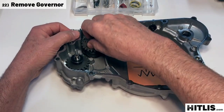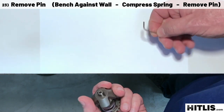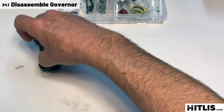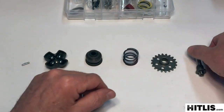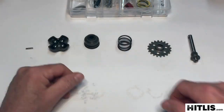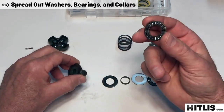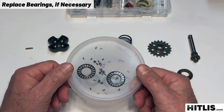Then lift up on the governor, lift the arm, pull it right up out of there. Go over to a bench up against a wall, grab a little Allen wrench and compress that spring, slide the pin out, and then you can take apart the governor. Set down the weights and the weight retainer. Pull the bearing stack and the rest apart. Then mark the orientation of that pinhole on the shaft — you're going to need to know that later. Disassemble the collars and washers and bearings. If your bearings are toast, get new bearings. They're like seven bucks a piece.